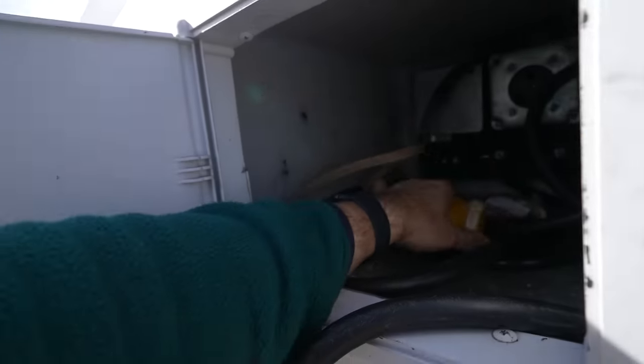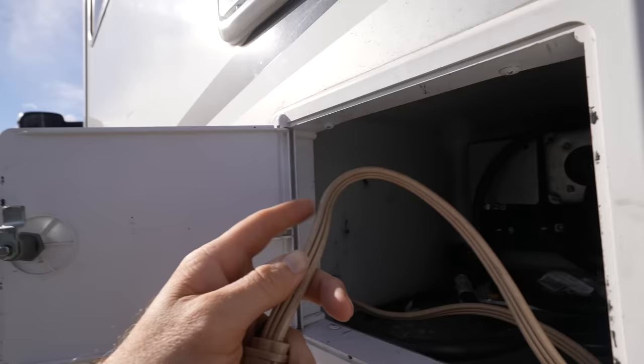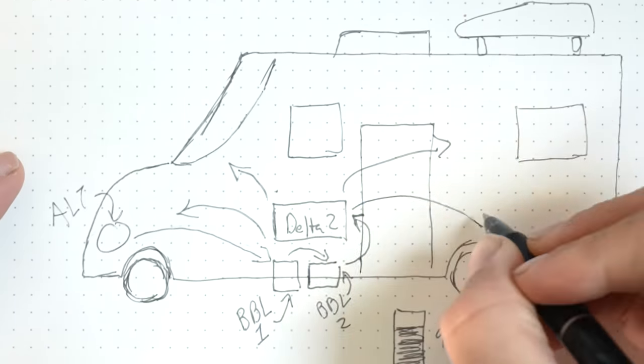Here's the super simple solution: when we unplug from shore power, I plug this power plug coming from the Delta II into the RV, and then we're inverted. I also flip the breaker for the converter so you don't have a power cycle loop. So there are basically two steps, but it's super easy. Every time we leave, out of habit, I do those two things. As long as we're driving or turning the van on at all, we've got continuous power. We're just running the microwave, Instant Pot, blender — everything is inverted in the whole rig. We basically don't even have to think about it. As long as we're turning the Viva on every once in a while, that's our generator.